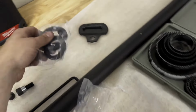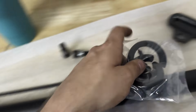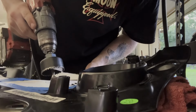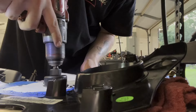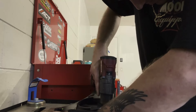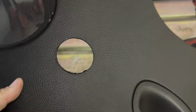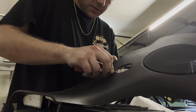And the only reason it really matters is because these grommets go in, so they sit on the side of this harness bar. What we're gonna do, hole saw, same thing, bang. Got our pilot hole drilled. Doesn't matter if it tears because I already got my pilot. Got hole saw, got our template. Turned out pretty good. Just be really light on it. This plastic's really easy to break. You'll probably do this with a file if you wanted to.